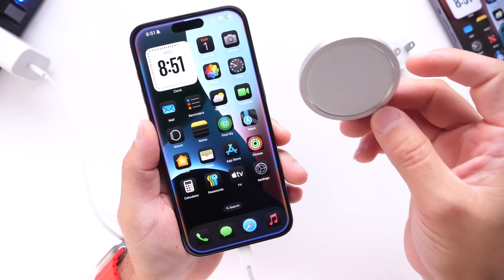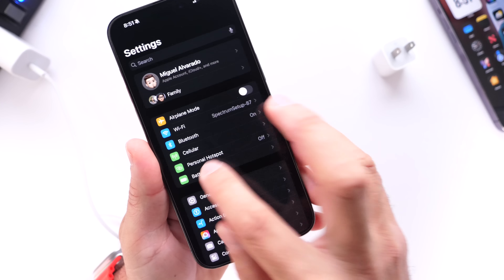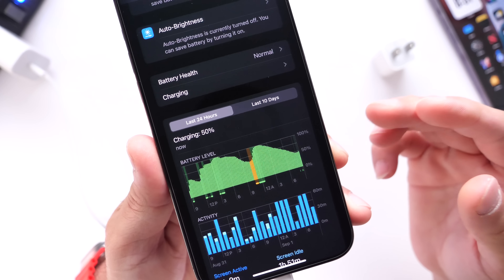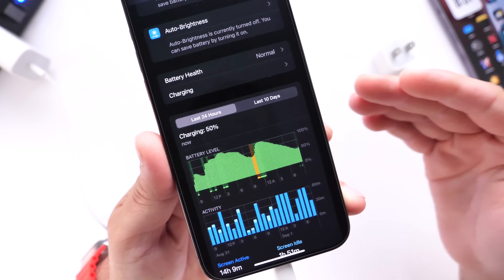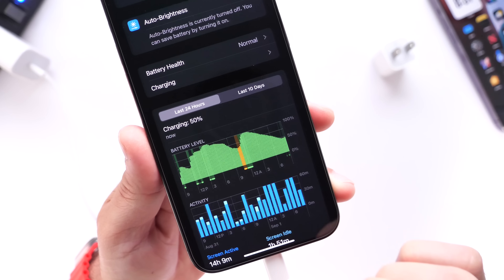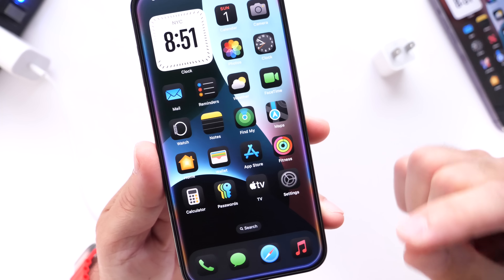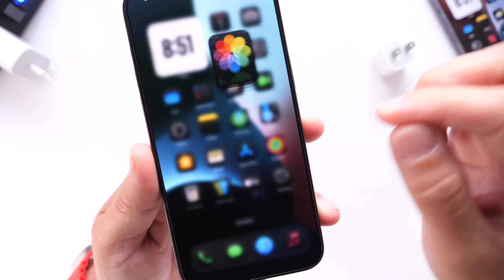This one is the Apple authentic charger, which can charge up to 15 watts of wireless charging. Let's jump into Settings and go into the battery section now with the 20-watt charger. Right there you can see we're not getting the slow prompt. The optimal charging on this device would be anything 20 watts or higher. I've noticed that anything 10 watts or lower will show those yellows on the charging meters. If you ever see this yellow, determine which charger you were using and replace it, because that means you're not charging at the fastest speed possible.